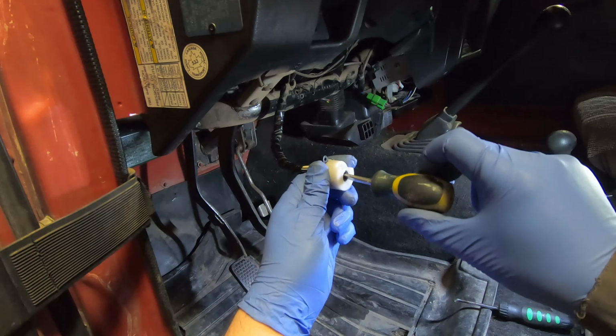Okay, now we're getting a bit crazy. So, on the theme of maybe there's too much slack inside the switch, I thought, well, what if I increase the pad width of the starter contact? So that, incidentally, is this one. So what I did is I took some solder, and you can see where the copper, hopefully you can see that, where the copper ends there, and I just put some solder on the outside of it. So basically just built up this pad a little bit more. So now I have about a millimeter and a half wider pad on the starting contact there. These are all, again, level. So I'm going to once again reassemble the switch, and hopefully that made a difference.